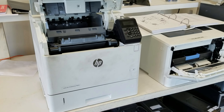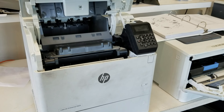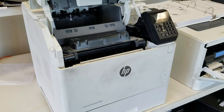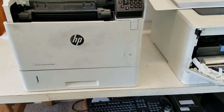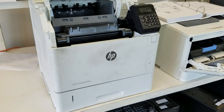In general, printer covers are interconnected by a tab lock system, flat head or Phillips head screws, or some combination of the three. Typically the smaller printers will utilize a tab lock system, while the larger workgroups like the 605 here will utilize the screw locking system.